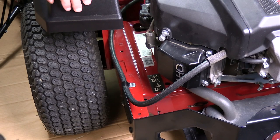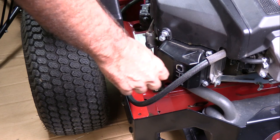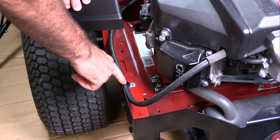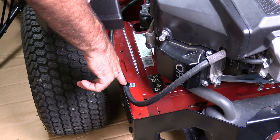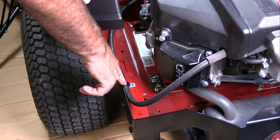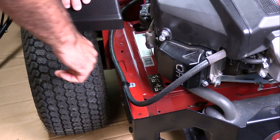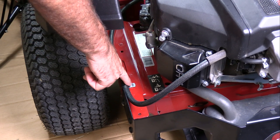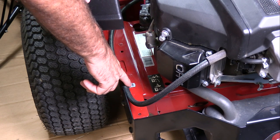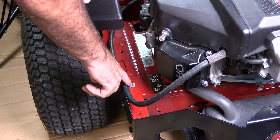Your lawnmower might be a little bit different, but in this case I'm working on a Toro zero turn time cutter lawnmower. I've got the fuel line coming out of the carburetor and I'm using this style of clamp that you can get from your automotive store — see the link below. I just ran it along the frame right here, keeping it out of the way. When you clamp those down with self-drilling screws, make sure to feel underneath to make sure there's not any wires or cables that you might screw into.